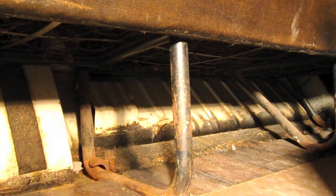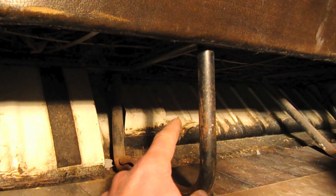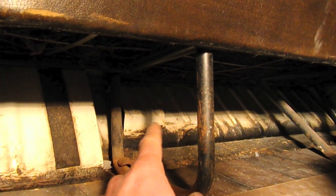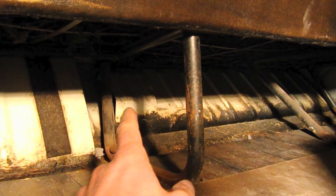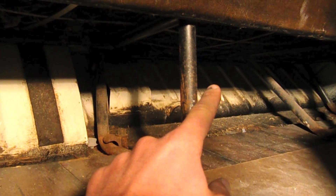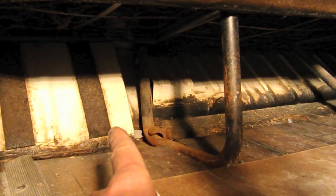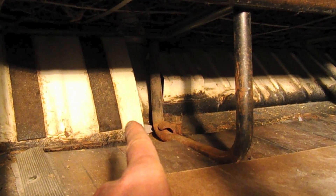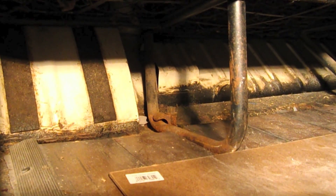Here at the rear seat — approximately where my finger is pointing, just next to the rear heater duct outlet — I'm going to drill my hole and mount the computer maybe a little further over, then put my battery closer to this side for easier access if I need to jump start somebody or be jump started. Next up I'm going to drill the hole and get that grommet mounted.